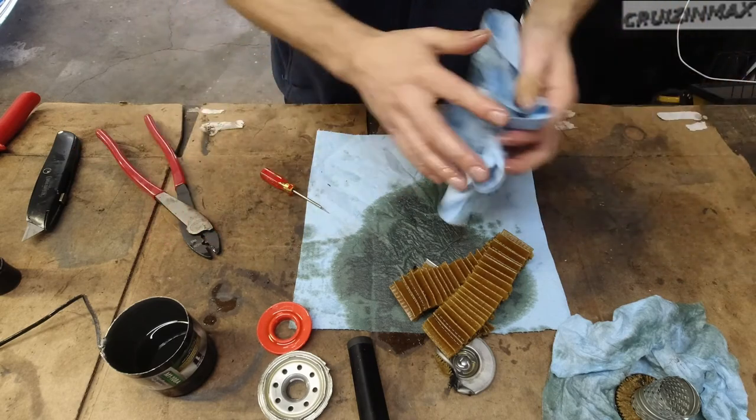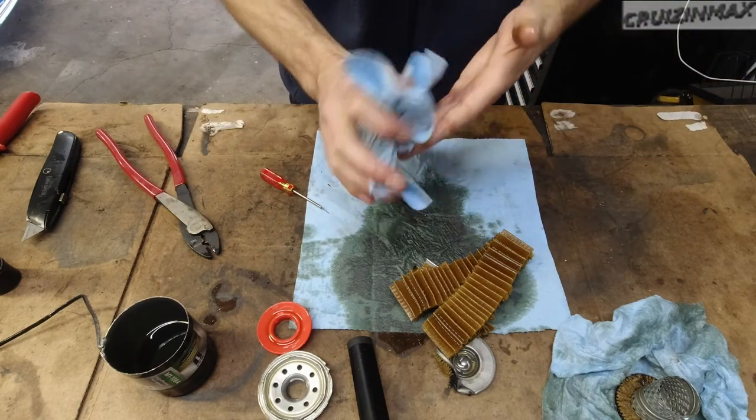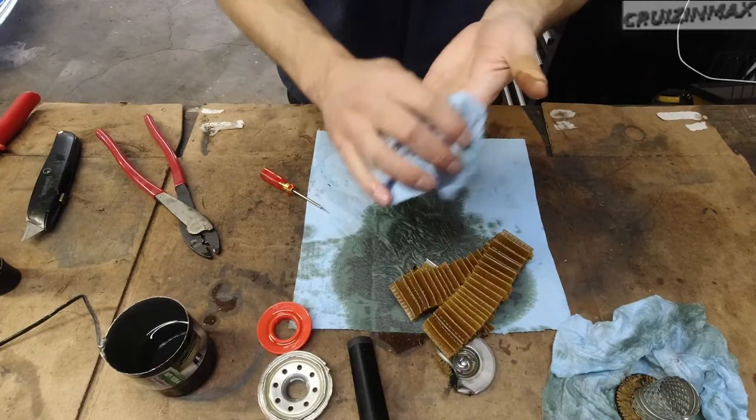This engine has about a thousand miles on it right now. And that's it — that's how you check your used oil filter. Like I said, this is mainly to catch early on if something bad is going on inside your engine. If you do catch something early, the repair bill will be less — whether that's replacing rod bearings or other components. Thanks for watching and I'll see you soon.